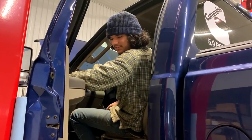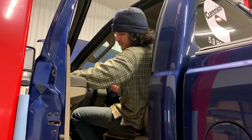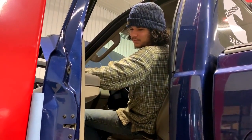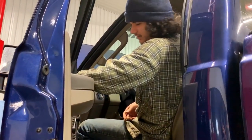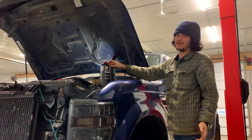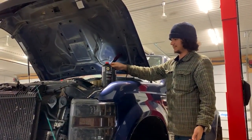I didn't do any research on whether it's different for a gas vehicle or a diesel vehicle, but we're doing the same we do our gas vehicles. We got one bled, so I was thinking, because diesel trucks, the brakes don't really work that well unless it's running because of your vacuum booster or whatever you call that thing. But it works for bleeding, I guess. You don't need it. The one took maybe 5 minutes at the most. The other side, I pumped it 10 times, bled it, and it was already done.